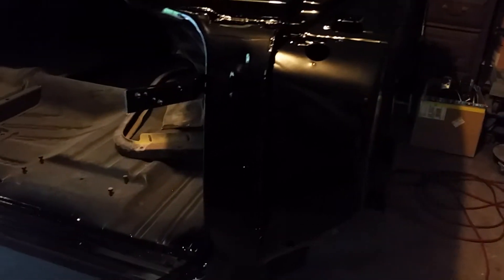I'm going to color sand and buff all the top and this main forward section of the firewall anyway, because when the hood's up at a show, I want that to look spot on. No runs, no sags — I'm happy. The very last coat, the fourth coat, I did as a flow coat; I really tried to make it flow out, so I did kind of hit it and then went back over it. But it was so hot in there with that fast activator, it just didn't let it sit long enough to get a clear run started.